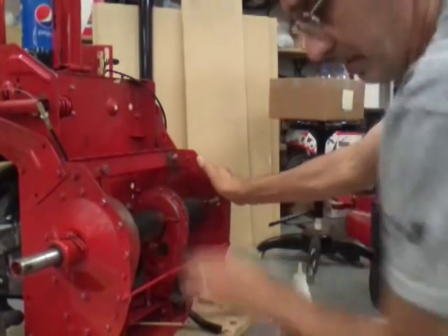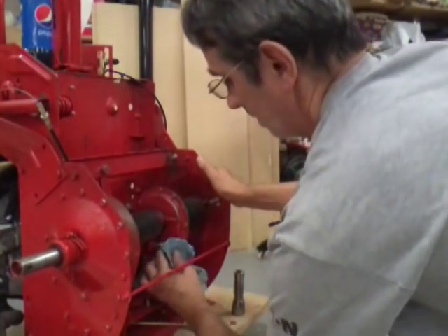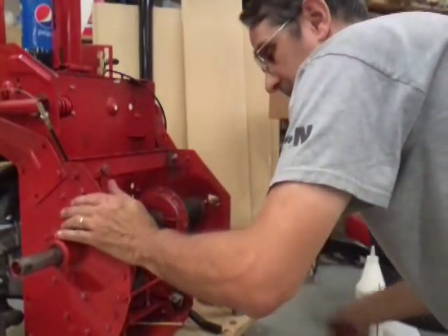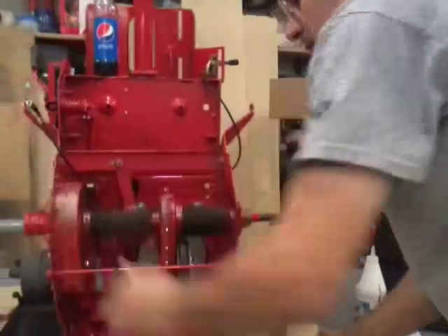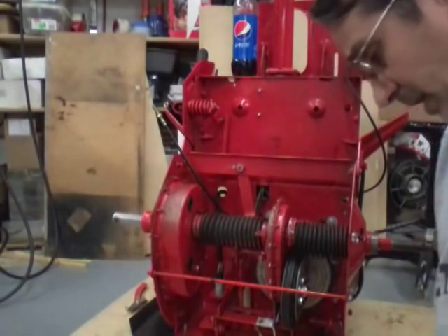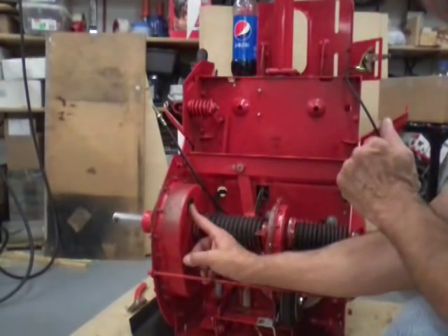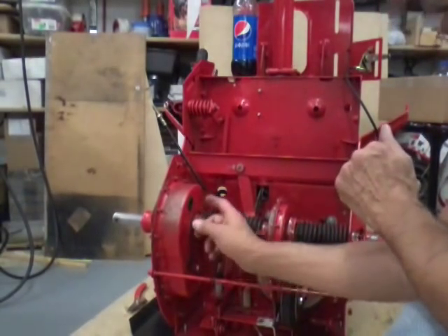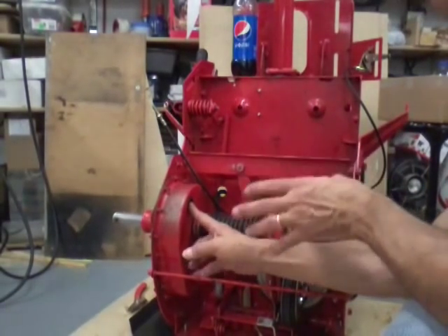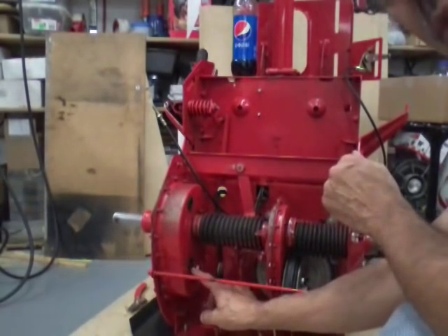Snap that plug back in and clean up the mess. On the other side there are two plugs on the differential. What the book tells you to do is take the top plug out and the bottom plug out, then squirt in either Snapper lube or 80/90 — whatever you want to use — until it fills the case up and starts running out the bottom hole.